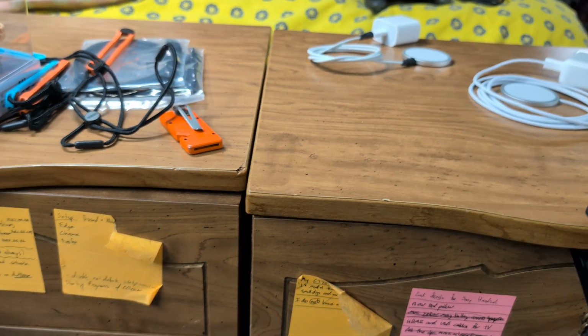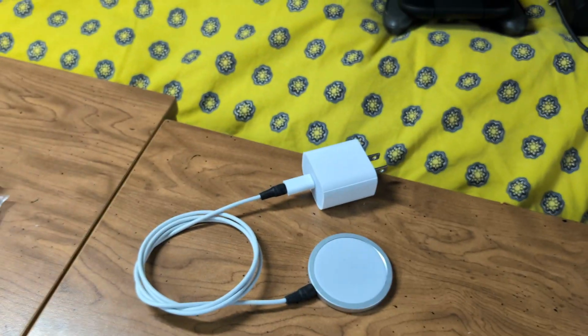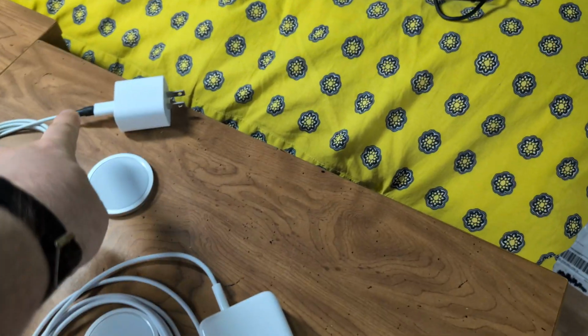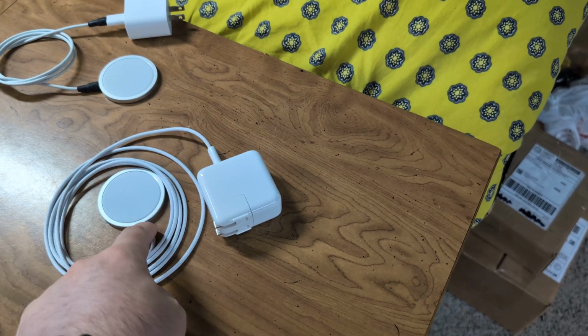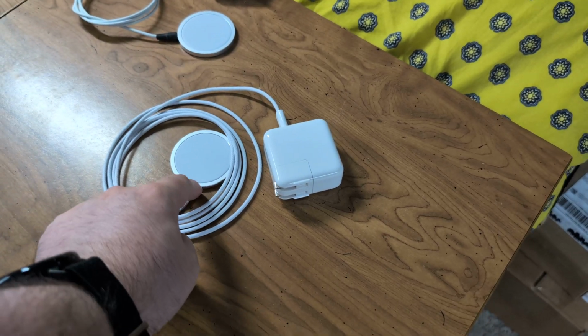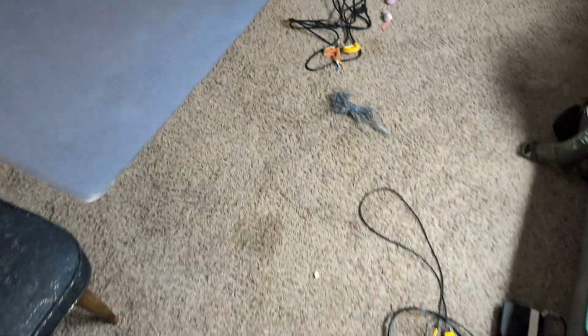I didn't do that on the Apple one because I can't on this end, and it would have looked weird to have a big bulbous thing. And then also I want enough strain relief going out this way because that's actually what really helps. Not just right on that hinge part there, but just extending out the force it takes to bend it. If you can make it bend further out, you're going to be better off.